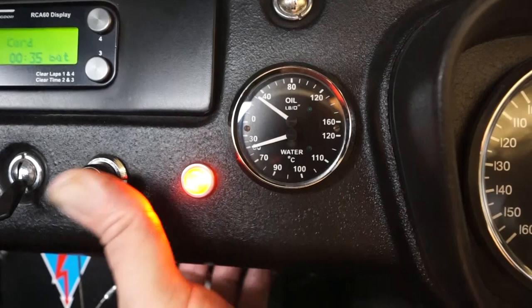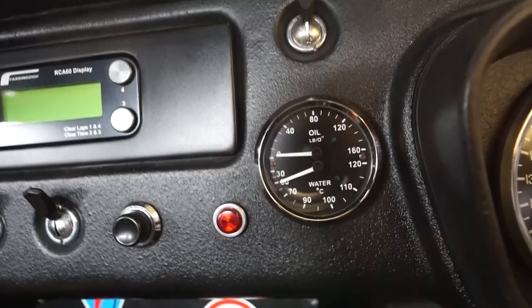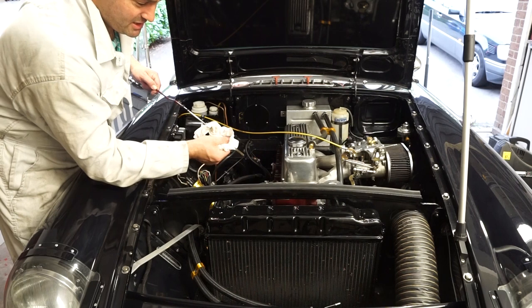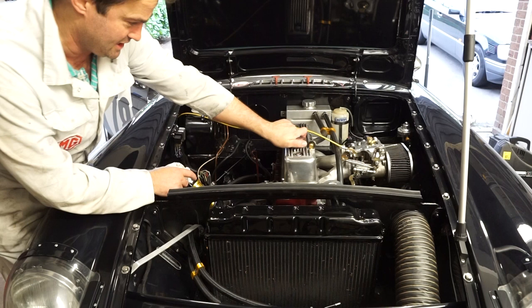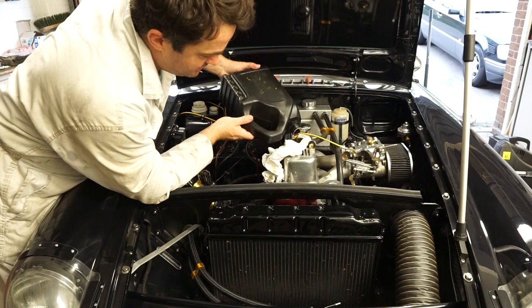You can see that's come onto the gauge there and the light just went out briefly. I'll put the ignition back off and we'll double-check the oil level again. Now we've turned the engine over and put the oil around the engine, I can see the level has actually dropped down quite considerably to just below the minimum. So I'm going to top it up again — cap off, just a little bit of paper around there, pop a bit in, and leave it a few minutes to drop down before checking the level.